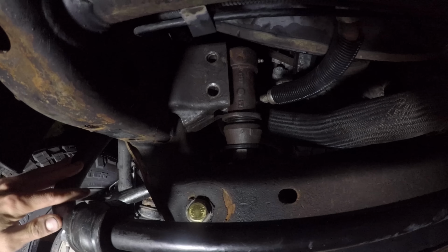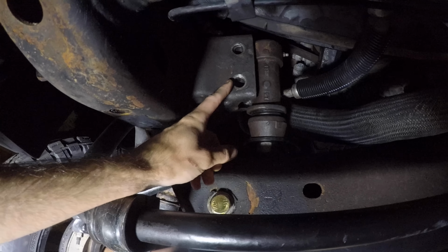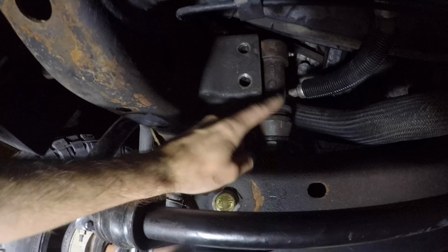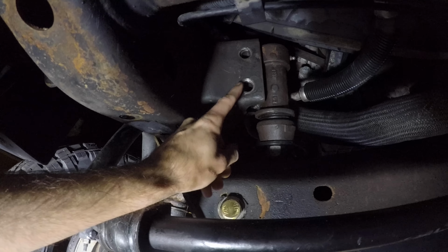Okay, so the idler arm support is now back in the bracket on the frame. So when the idler arm support came out of the mounting bracket here, it came this way. It was really a pain in the butt to get it back in. I had to sweep the steering left to right to get it into place and then use a tapered punch to line up the holes. But now that I've done that, I can get these bolts in here snugged,